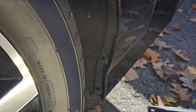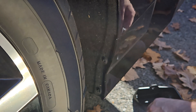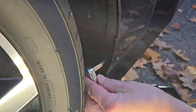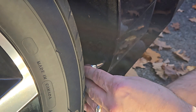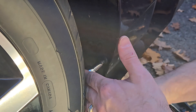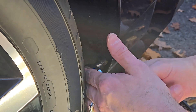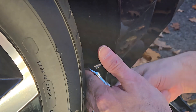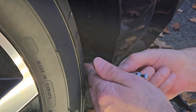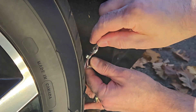It's a little tough to get in here. If you only have a screwdriver it would be very tough, but if you have a ratchet then you can do it this way. Or you can take the wheel off, which is a heck of a lot more work — and you need to make sure you're using a jack that won't harm the pinch welds on the underside of the frame. So unless you're really adventurous, just take your time.